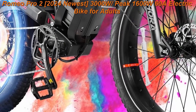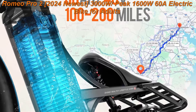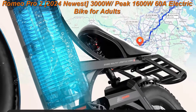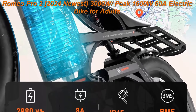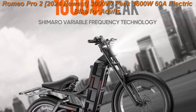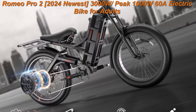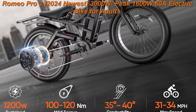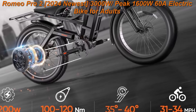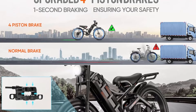This is the third version of E-Hora Romeo Pro Electric Bike. New features include an 8A charger, a cover plate on the bottom of the battery, 20x5.0 wider and longer fenders, full twist throttle, optimized headlight plus tail light with brake lights, internal electronic control wiring, optimized 1200W peaked 1600W motor, and 30A controller.